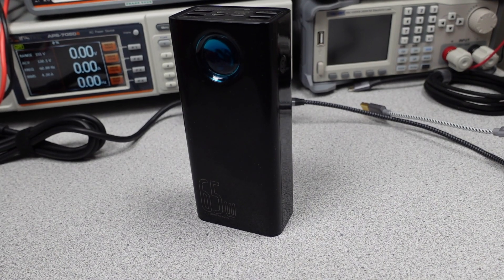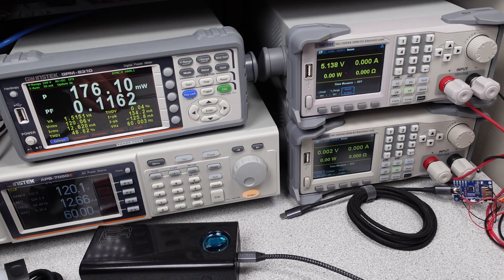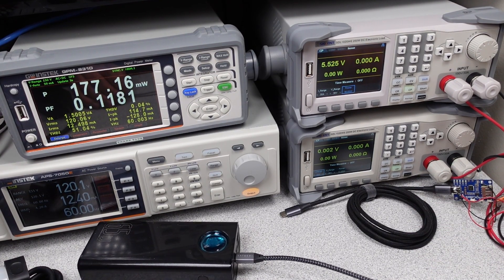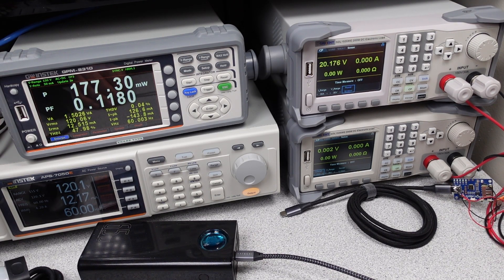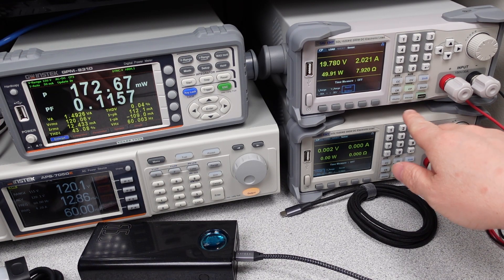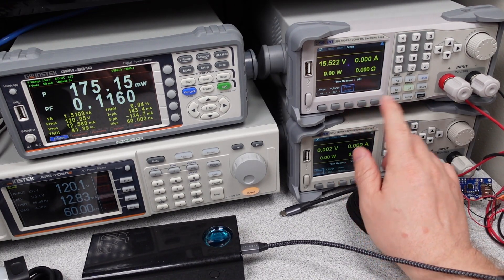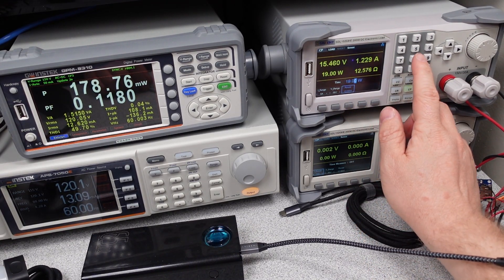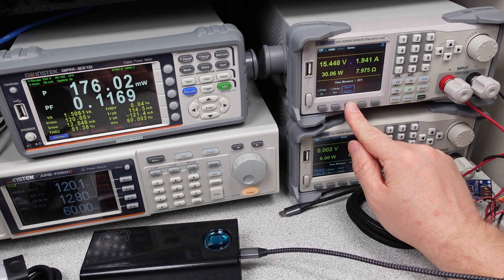The USB-C port is a more modern and much more popular power delivery output. The power delivery specification allows each USB-C port to deliver fixed or variable output voltages depending on your needs. In this case, the Powerbank provides 5, 9, 12, 15, and 20 volt fixed output voltage modes — not bad and in line with most modern devices still. The other mode available is PPS, or Programmable Power Supply mode, which varies the output voltage to maximize charge efficiency. The port offers a PPS mode up to 16 volts and can go up to 65 watts.